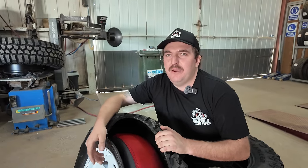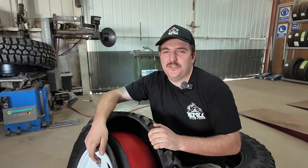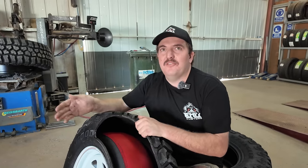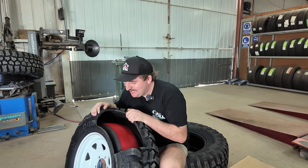When you go for a bolted bead lock, the things I look at is the actual design of how the bolts screw in, if they screw into metal or aluminium. There's all these things that I've got to look at, and it limits me to a certain few rims that I've got to pick out of. You can put this in a bolted beadlock if you want. You literally put this in anything.